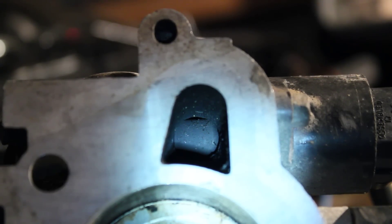At 240 it's still not quite closed, and at 255 you can hear it bottom out and skip a couple steps on the stepper. So somewhere around 250, I'd guess, is about where it's all the way closed. I can tell TunerStudio that that's where I need to be when I'm in fully warmed-up mode.